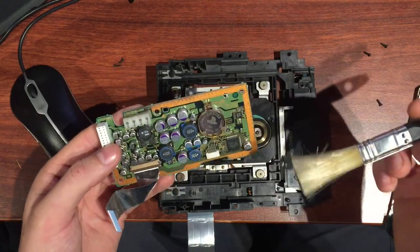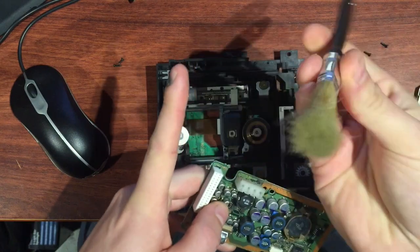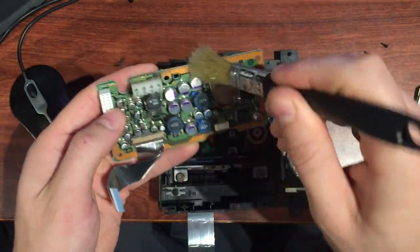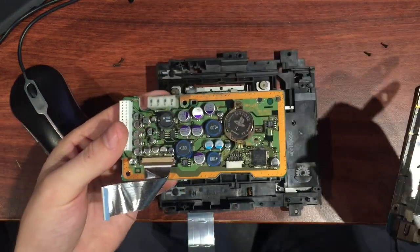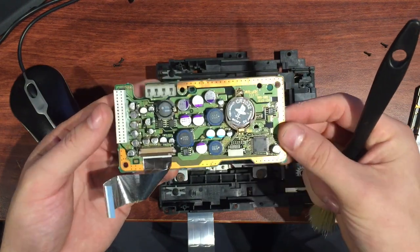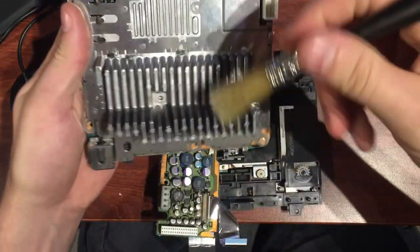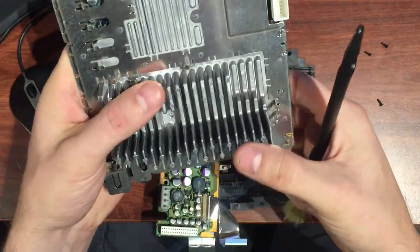The cleaning process is pretty straightforward. What I like to do is get a small paintbrush — just a really delicate one with soft bristles — and go through and really dust it all out. It's not going to cause any damage and it's a really effective way to get the dust out of all the places. I've already done this outside because dust goes everywhere. Go through each piece of electronics first — the motherboard especially. Get through all these heatsink fins, take the board, take the cover back off, and get under the board there.